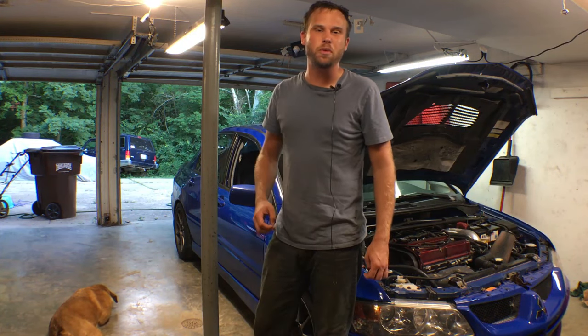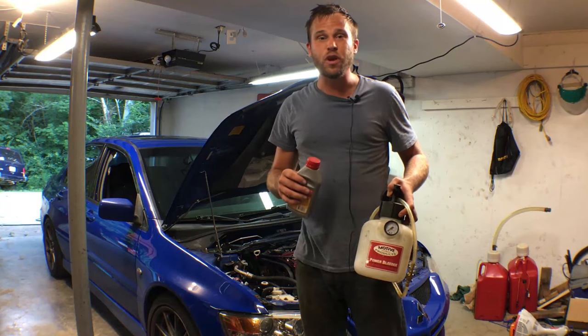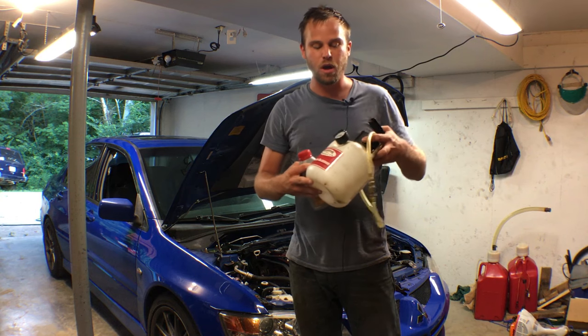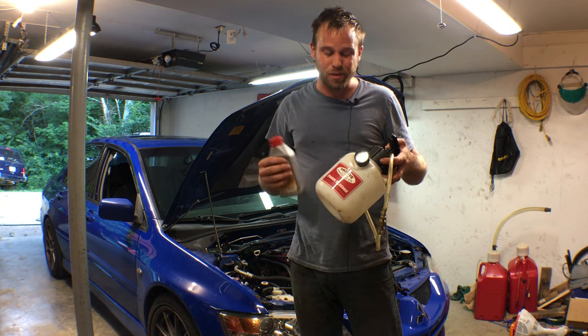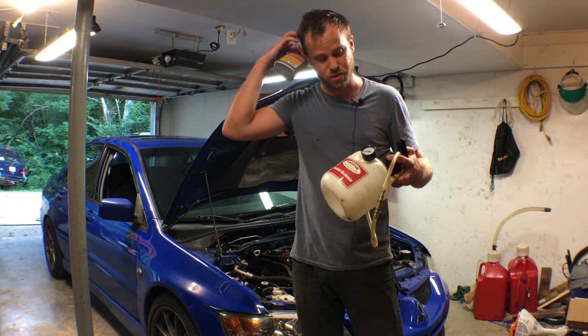To be able to bleed the clutch by yourself, you're gonna need a dog strong enough to press the clutch pedal down. If you have a cat or a dog under 60 pounds, you're gonna need to go buy a Motive power bleeder. What this does is it pressurizes the master cylinder so you don't want to have someone sitting inside the car pumping. You can get it probably on Amazon. I think I paid $45 for it maybe 7 years ago, 6 years ago.